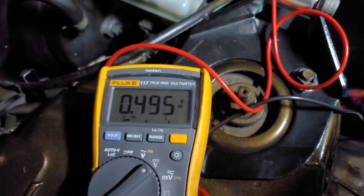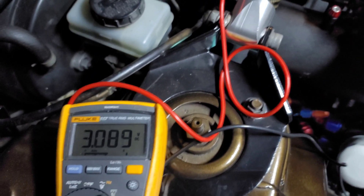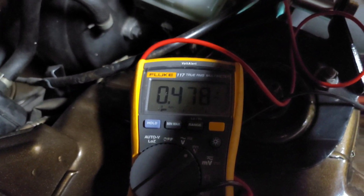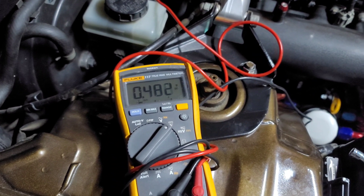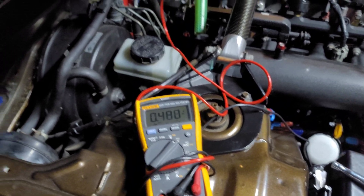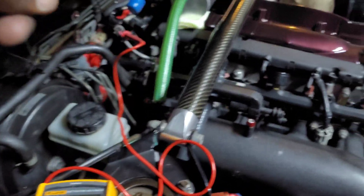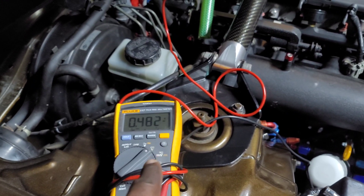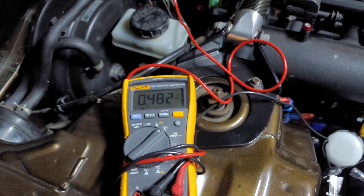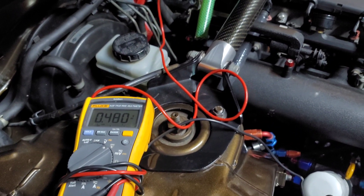At idle it's back at 0.48V. Wide open throttle reads 3.8V — so we're going to try this. If I have to, I'll keep adjusting. Some people get different numbers but we'll keep going with this. That's how you set a throttle position sensor — or you can set it with the ECU. With an aftermarket ECU like a Link, you can see the voltage in the data screen. Pretty much that's it — I'll follow up.